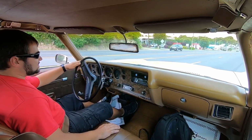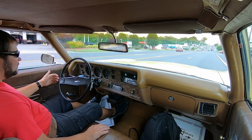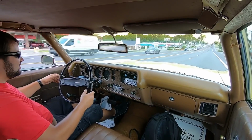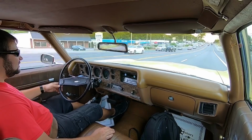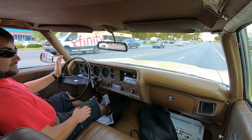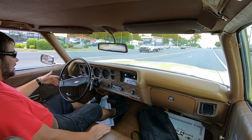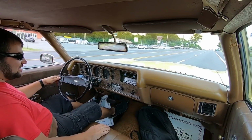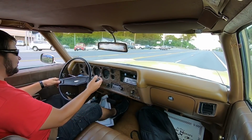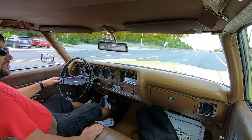So as I'm pulling out, I see the speedometer's coming up. Car's going straight as an arrow. Steering's pretty tight. Nobody's behind us. Brakes. They're stopping fast. That works good. All right, see if the kickdown passing gear's hooked up. I don't think it is. Manually shift down.